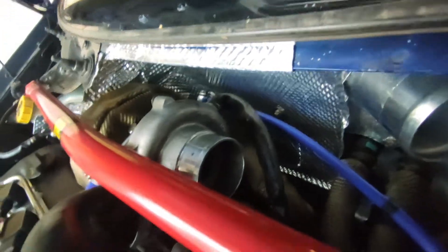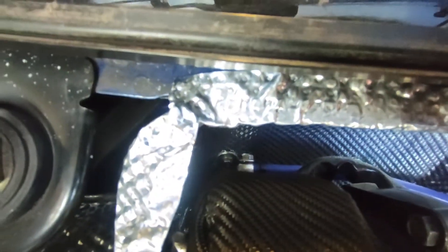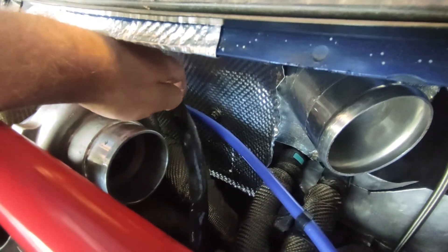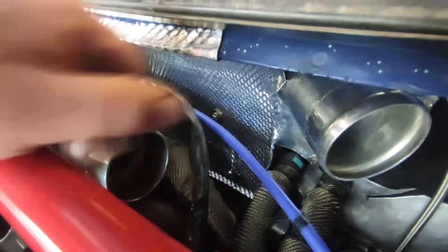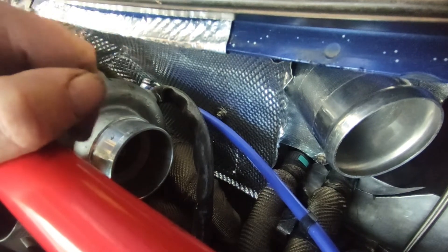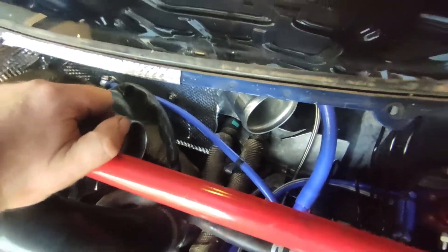What I'm going to do first — because obviously that is tucked down in the way — is get a vacuum gauge and take this pipe off and see if I can hear it moving inside, make sure it's moving freely. Make sure it's holding vacuum, because I'm hoping it still could be the unions on the top. Well, not so much the top, because that's when I come to turn on the actual boost controller, which isn't active yet. It's literally just down to this pipe here for wastegate pressure. So as long as that can hold pressure and the wastegate opens, I'll get the tool and give that a test. See where we go.